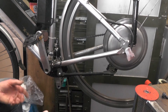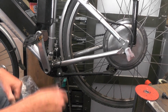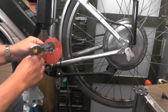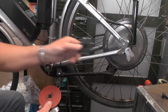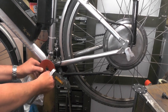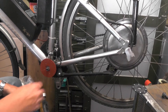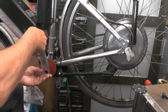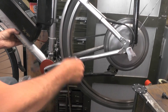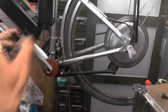It doesn't do it so much on the flat. I made another ring with four magnets — half the magnets — and you'd think that would slow it down because the pedal's got to move in a bigger arc for each magnet. It did slow it down; it stopped it from kicking in as quick. I've been using this one and it works fine, even on hills. No matter how fast I go, it stays in.